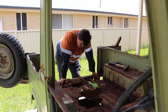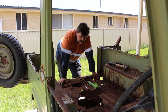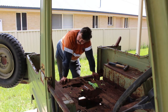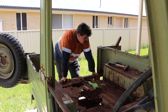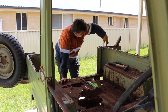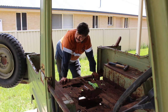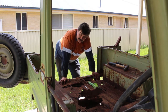Because these are pretty bad, but I know someone with a brake press and it's not a very complicated shape to fold up. Once the floor's out, it's out, and then you can access whatever you want. I keep nibbling my way along here with the cold chisel and see what we can see. They've actually got two models of F10 - we never got the other one here. They've got an F10 and an F10L, so all the F10s in Australia are F10Ls. L for long - there's actually a seam just behind this rear wheel tub, and the long is the fact that it's got that in it. This portion of floor is missing and that corner's there. They didn't actually change any of the wheelbase or anything - it's literally just a skin and tub modification. They put this little piece in here, put a piece in the floor there, and that's it - you've got yourself an F10L.